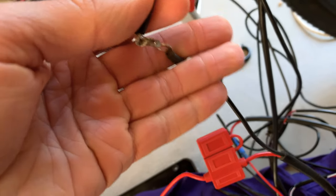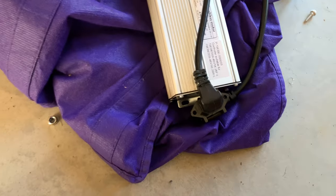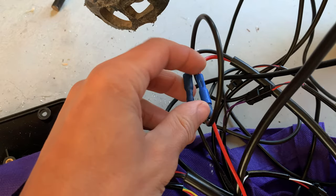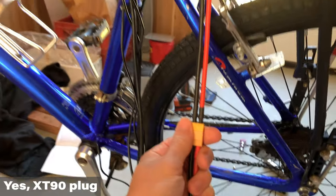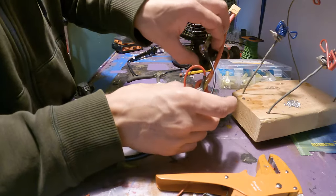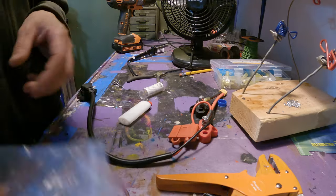Basically what I have to do is buy some terminals to then screw together O-rings and have mounting points. That red thing is the fuse — it's a 30-amp car fuse, you get them for super cheap, and this came with two. Then there's this weird plug that I assume is what plugs are like in China — maybe wall plugs. There are actual waterproof connectors that connect to the control unit, so there's no real reason for this other plug to be here. You've got raw wires and you've got to use your imagination. I'm choosing to use pole terminals so that if something comes loose, it's hard for it to come completely apart.